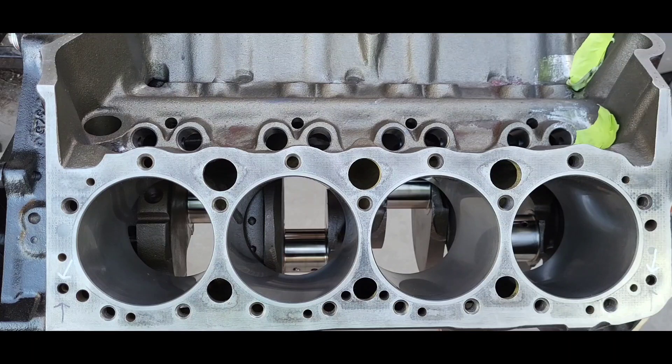After checking the crank for straightness, I like to check the cam journal to cam bearing clearance and the lifter bore diameter. As you know, 0.842 inches is the diameter of a small block Chevy lifter, and the allowance is 0.0015 — in other words, a thou and a half. I measured these and got 0.8429, 0.8434, and 0.8442. The limit would be 0.8435.